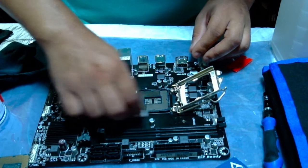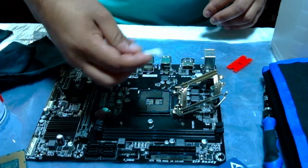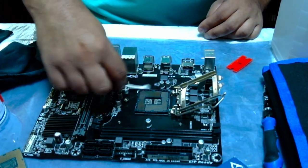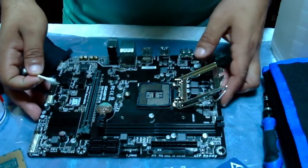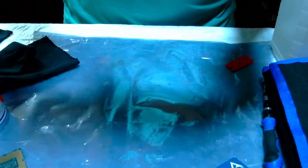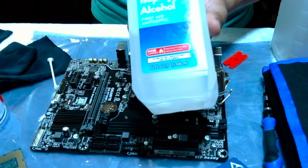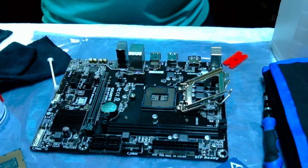First of all, you would see the mark of the dirt on the motherboard, and you would definitely see it on this Q-tip — the dirt would show up black. So it was actually not that bad. I just wanted to put alcohol in it, and the alcohol does not damage the socket at all, as long as you use 91% or 70% alcohol — either one works fine.